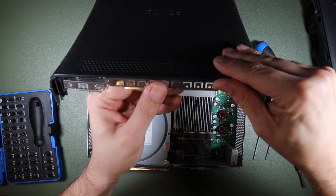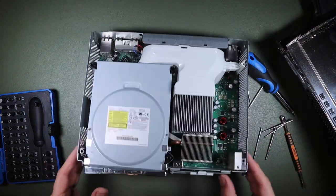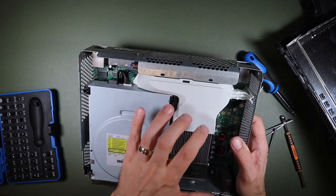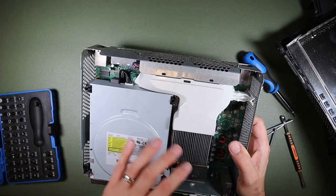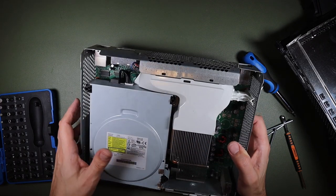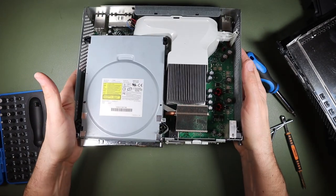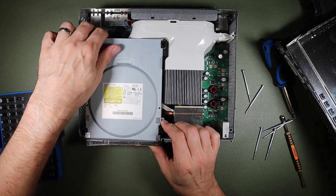Boy, is there some dirt in here — that's absolutely filthy. I guess I have more work to do to get to the motherboard. What I'm trying to do is get all this out of the way so I can apply some heat to the motherboard and see if I can resolder. I understand from what I've read online that this is an issue with the Xbox 360 and the kind of problems we've been seeing.